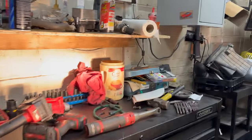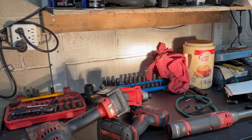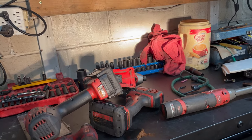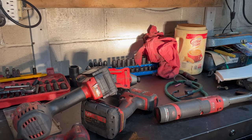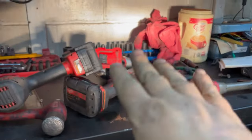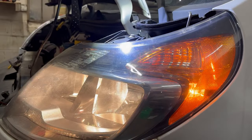Let's go down. Let's turn on the high beams and see if that makes it any more visually interesting. Counterclockwise here — should be dropping this down. Where to put it? That's up to you. I can see the high beam coming down quite well. You'll find the sweet spot. The problem with having them too high off the road is that they're going to illuminate snow and rain and look like warp drive and screw up your brains. And having them way too low means all you're going to see is the road — you're not going to see that deer or those children in a pram. So that is the vertical adjustment — pretty simple.